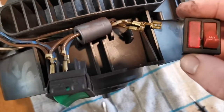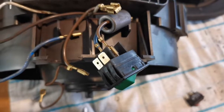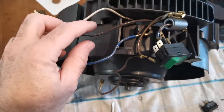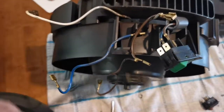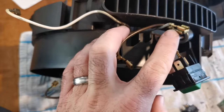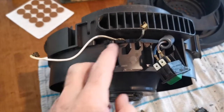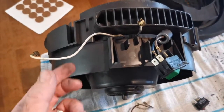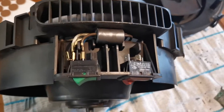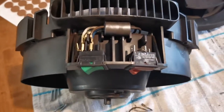Step one is to remove the connections from the turbo switch. Step two, disconnect the PCB so you've got these four connections loose, then remove the two end connections from the power switch. Once all that's done, remove the wires that aren't connected to anything, and disconnect this brown wire from the spade that the white wire is connected to. That will leave you with the two motor wires - connect those to either of those terminals. As you can see they're both white, which means there's no polarity, so it doesn't matter which order you connect them in. Tidy up the wires, tuck them in a bit, add the switches back in, and then we can test it.